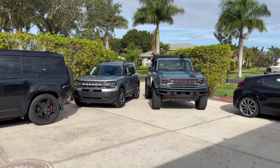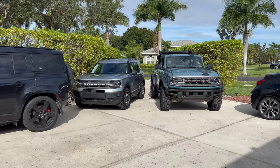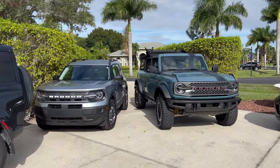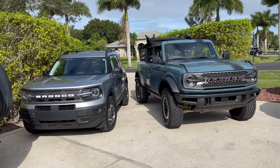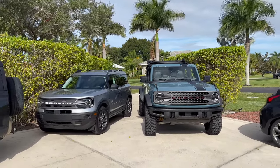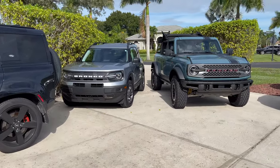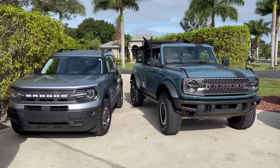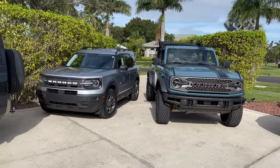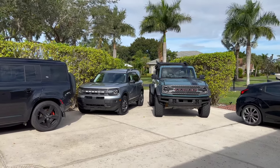So let me go grab one of those outlines, come back out here, clean it off with interior cleaner, and we'll get right into the install. It's going to be a dry install — just be cognizant of that initial placement of the corner. You can do a wet install, but you're going to want to wait until it dries out, or it might slide around a little bit. You can get a hairdryer or a heat gun and lightly apply heat to encourage it to dry out. If it burns you, it's probably too hot for the vinyl. Especially with thin outlines, those get stretched out really easily. We are also going to give you two sets so you become familiar with our products and how they install — so you'll have that second chance immediately without having to reorder.